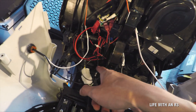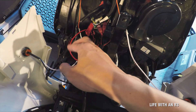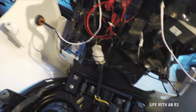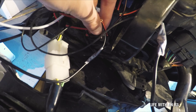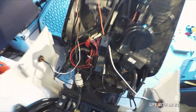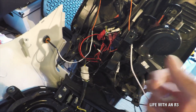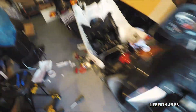In my case I'm connecting through my black wire which is my negative or ground. You just want to focus on the two voltage meter wires — one going to the positive and the other going to the negative. I've loosened the negative connection a bit, but just for the sake of this video. Basically, that's pretty much it — wire it to a power source that's live when the key is on, and let's turn on the bike.